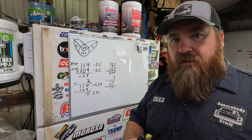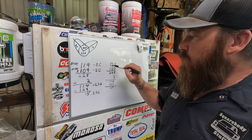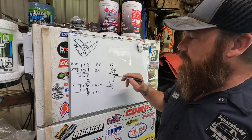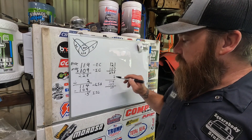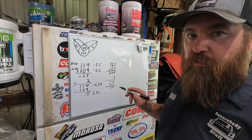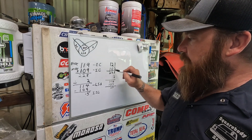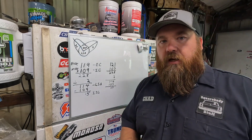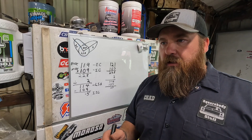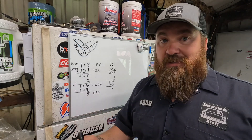I've gone through and double-checked it with the degree wheel to make sure everything lines up right. It comes out to 121 on your exhaust centerline and 107 on the intake centerline. You still get 228 total degrees — divide that by two and we still get our 114 degree lobe separation angle. Then you compare the intake centerline of 107 to the LSA, and that gets us plus 7 degrees advanced. It seems like a lot of advance, but when I researched nitrous and power adder applications, they typically like from 6 to 8 degrees.